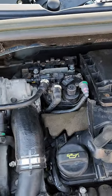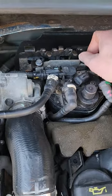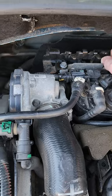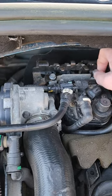I had a MAP sensor fault on my car, found out it's behind here. I've undone these bolts before — two 10mm bolts. Let me get them out.